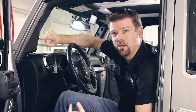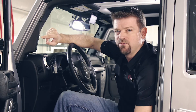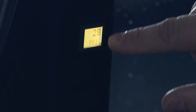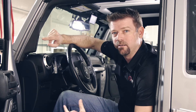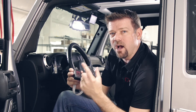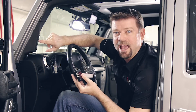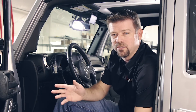We tap the screen again and on this Jeep, we have our optional air pressure monitoring system. A little sensor can be screwed into your air pressure tank to monitor your onboard air pressure — this is for something like an ARB or a Via Air compressor, not for your tire pressure. Right now my air compressor is off but there's a little bit of air left in my tank. If you don't have the optional air pressure sensor plugged in, you won't see this screen at all. If you want to run it, it comes with another cable that plugs into the second port on the interface module. As soon as you plug that in, the G-Screen will detect it and immediately add the PSI screen. Everything's plug and play, modular, and very easy to install — no air hoses to run, no wiring to figure out.